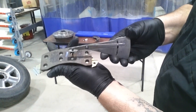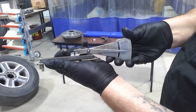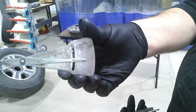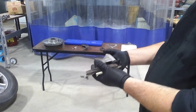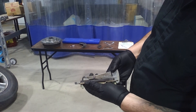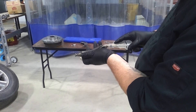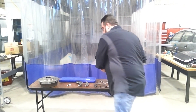What you want to do is measure it off the rivet head. This is going into the hole, and you want to press it down and make sure it is flush with the top of the lining. Then you would get your measurement. I'm seeing that would be right at seven on that one. You want to measure more than one riveted lining, so I'm going to take a couple more measurements just to verify — seven, seven, eight. That will be seven thirty-seconds of an inch.